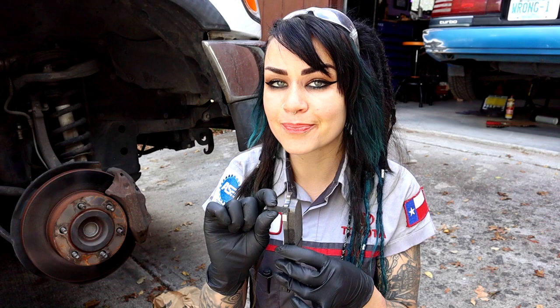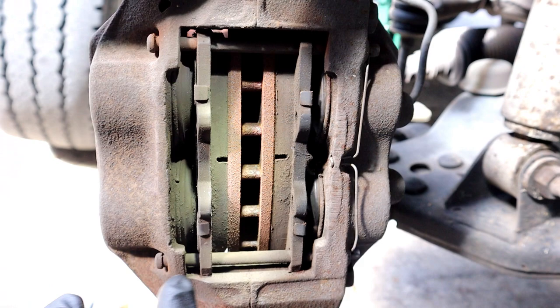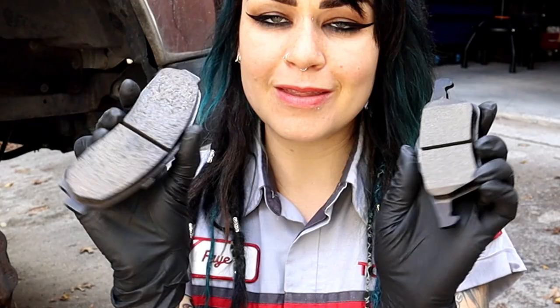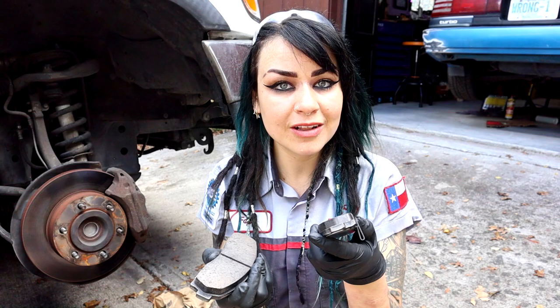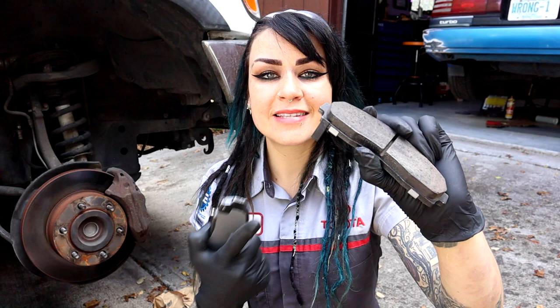There can also be the failure of the technician to put the squealer tab in the right place. My brake calipers have caliper pistons on both the front and rear of the caliper, so all pistons push out and put equal force on the inside and outside pad. But on a single-piston caliper — more common on smaller passenger cars — the inside pad is going to wear a lot earlier than the outside pad. So if the squealer tab is placed on the outside pad, the inside pad can go metal-to-metal while the outside pad still has life left and hasn't triggered any noise. Human interference is kind of a big deal.